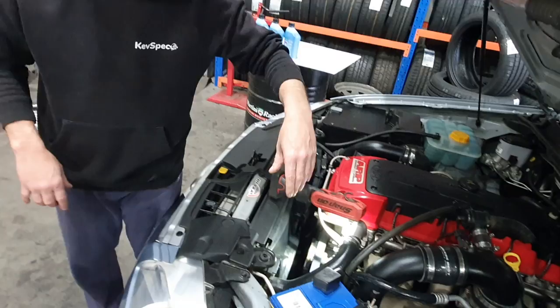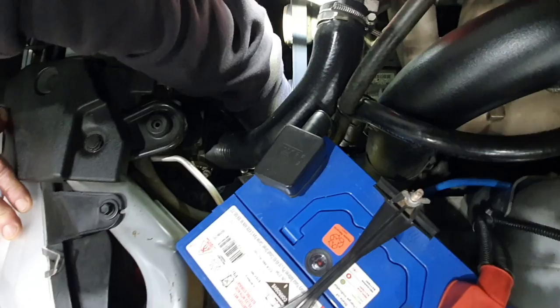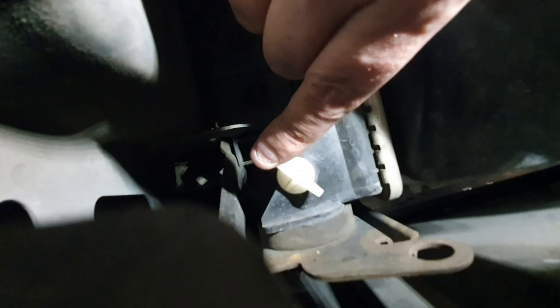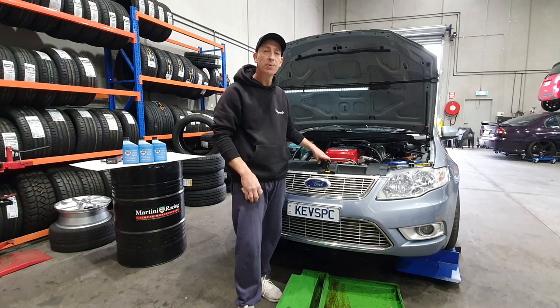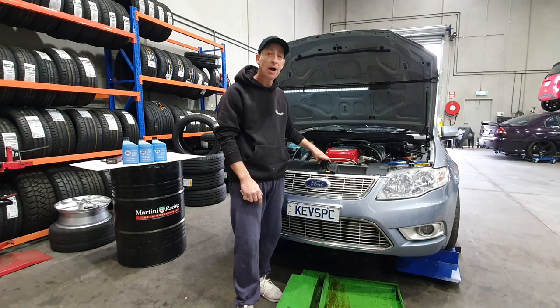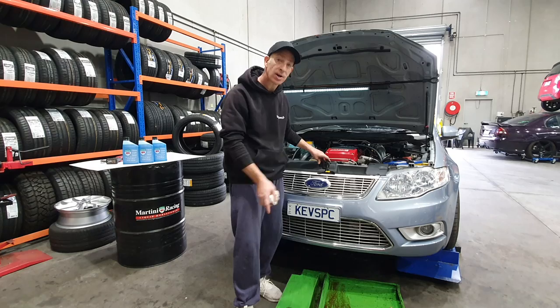So just down here, you reach down and feel for the bottom — I'll show you the location of it. That's the little valve right there that you undo to drain your radiator. You can see clearly there's a little white tap. Just undo that and it drains your radiator. Now, when you're doing any kind of cooling system work or draining any liquids from your vehicle, please dispose of them responsibly. Chuck them in a couple of bottles and take them to your local mechanic — they'll be happy to dispose of it for you. Try to capture as much as you can and dispose of it properly.